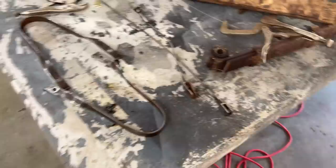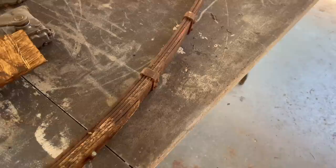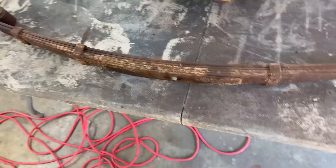And I'm probably going to try to clean the springs up a little bit with a wire brush. Probably give them a quick paint, although it probably won't stay much. And then we're going to oil them, I think, with some old motor oil. I think the manual calls for them to be oiled between the leaves with old motor oil. So we'll probably end up brushing these with oil anyway, which will probably end up destroying the paint. But anyway, things are looking good. We're getting pretty close to getting these into paint.